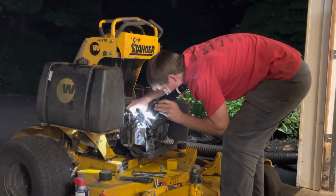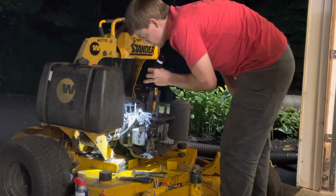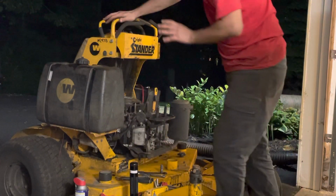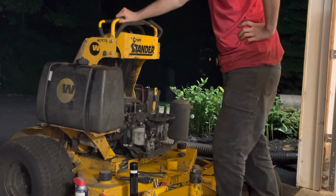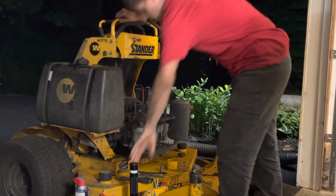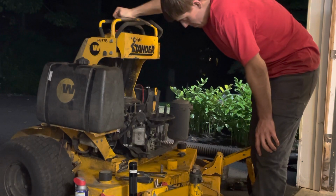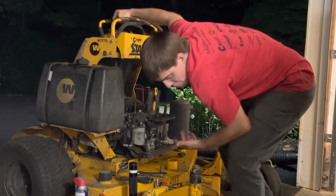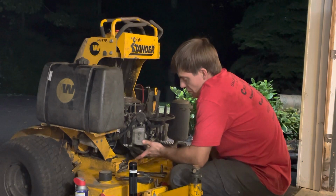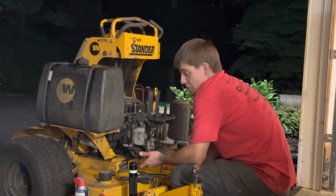That gasket looks like it was intact, and this one here we know was already good. So maybe that wasn't the problem. A little premature on it, but if I had some brake parts cleaner, I could have resolved it. I could have at least felt it out. The way it's looking, that head is no good. Correction, the head is no good because the valve guide has moved in it. But I have seen them run with that valve guide moved. But that seems to be the case right now.